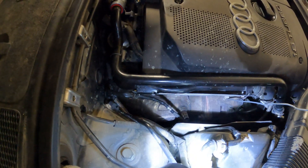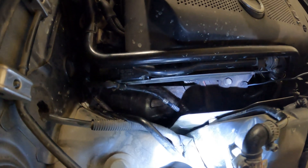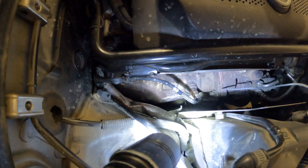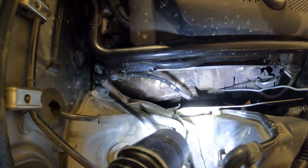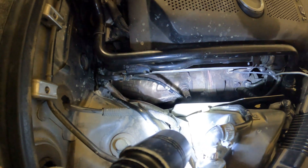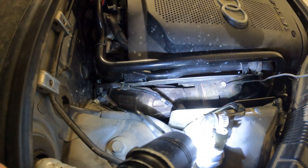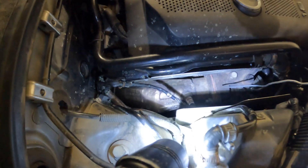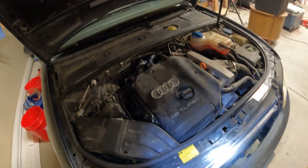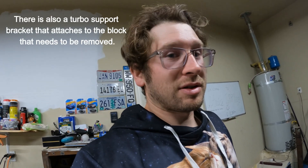We're going to want to remove — there are three big bolts on the top of the exhaust, you have to remove those, kind of hard. Then there are the flange bolts that actually connect it to the exhaust pipe, so there are three of those nuts, and then it'll separate. Those are the hardest things to get off. The three on top go to the manifold, and then these three for the flange. There's a coolant line as well that goes into the side of the block — that one's kind of tricky to get to. There's also the oil feed line, but that's pretty easy.